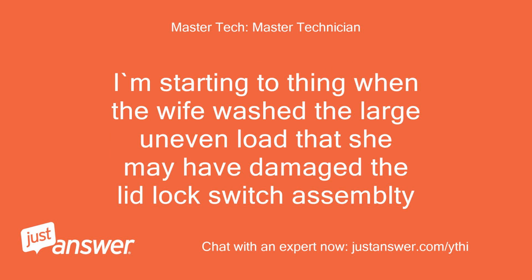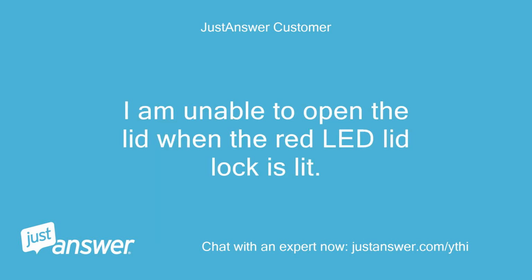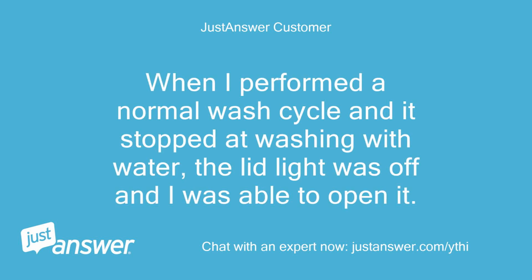I'm starting to think when the wife washed the large uneven load that she may have damaged the lid lock switch assembly. The lid is locked and works. I am unable to open the lid when the red LED lid lock is lit. When I performed a normal wash cycle and it stopped at washing with water, the lid light was off and I was able to open it.